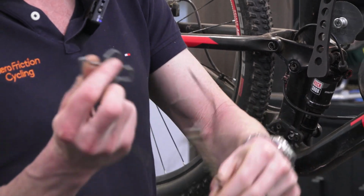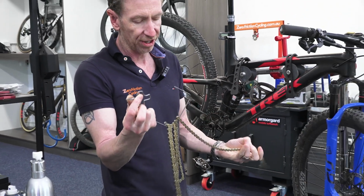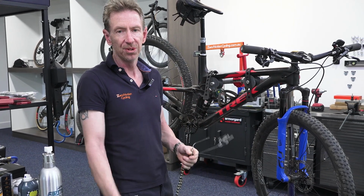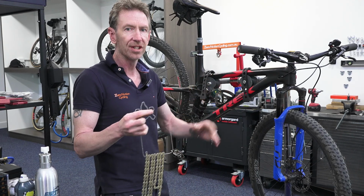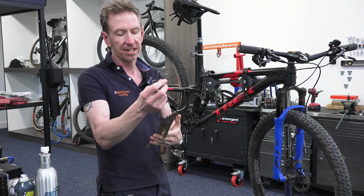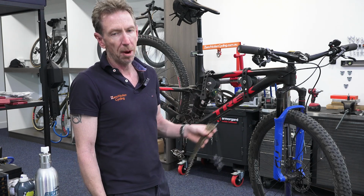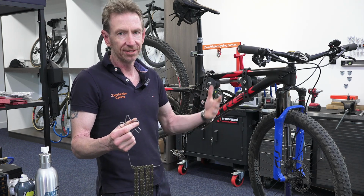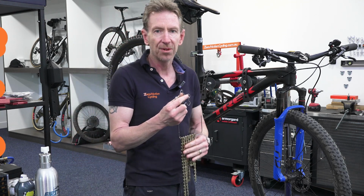But even if you don't bother with a two-pot system, which honestly is certainly not something you should feel you have to do to get the best out of waxing, just immersive waxing gives you the huge benefits, and even just one pot, one bag of wax, you're absolutely fine. But that simple tip of removing the surface dust from your off-road rides before you pop it in the wax pot keeps that wax more amazing for longer, without that abrasive contamination going in it. So that's that part for the FAQ.